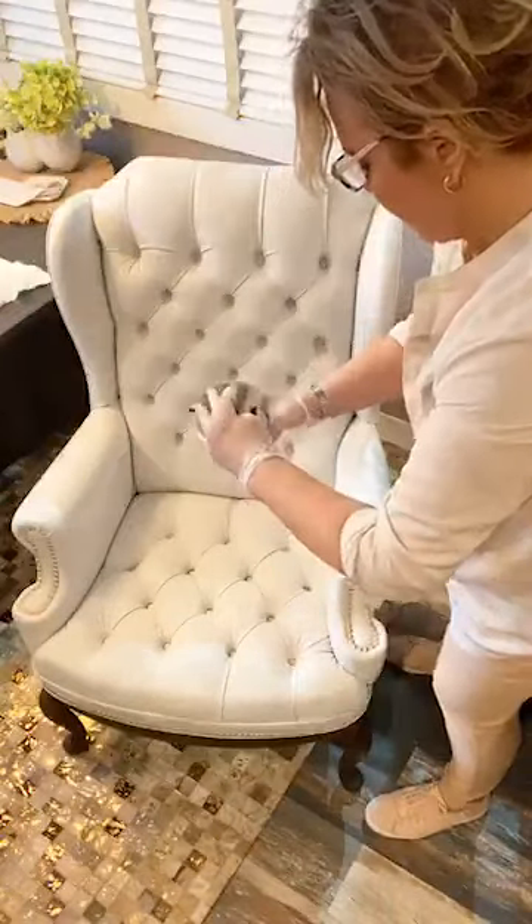Our friend William wants to know how long the dry time is going to be since this has been painted before. It's going to dry pretty quickly because it's definitely already cured out. There is no cure time on leathers and vinyls — it's not 30 days before you can sit on it. The paint just needs to dry well. You could probably sit on this in about an hour, but those little button tufts may have pulled up the paint, so just give it a minute. It will not rub off on your clothes.